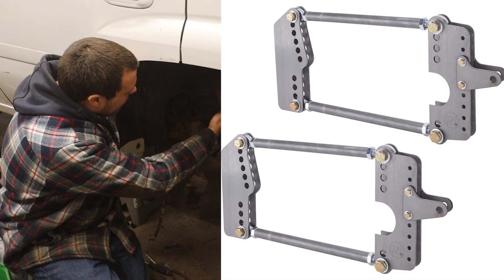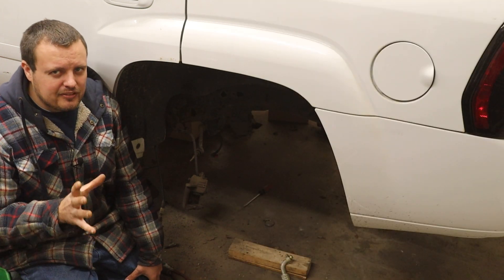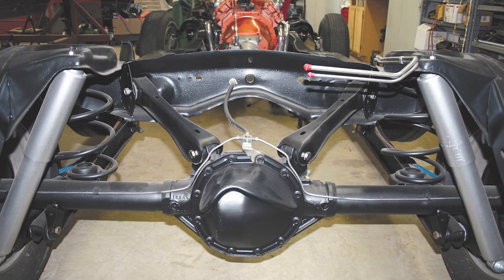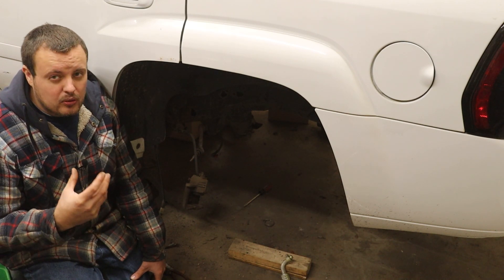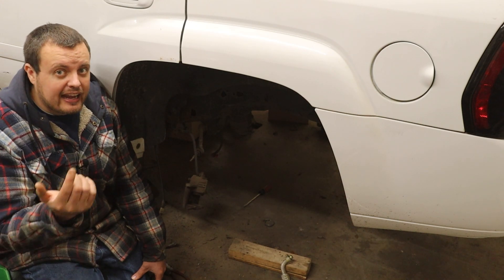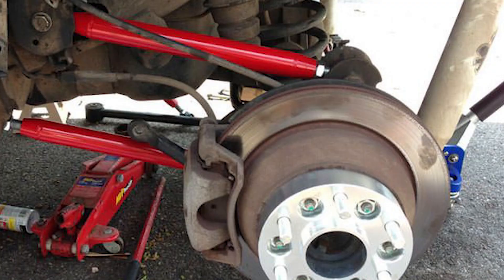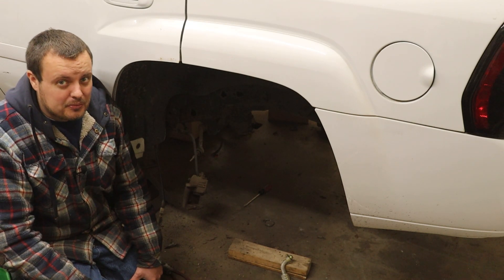A lot of times you'll see these brackets with tons of holes in them on the top and bottom so that they can be made adjustable. Most of the time, if you see a four-link on a factory vehicle, it is what is called a triangulated four-link — like what you'd see on a Chevelle or a Fox body Mustang. These are also a great suspension type, but on more serious drag cars you will almost always see a parallel four-link. What's cool about this vehicle is it has a parallel four-link from the factory, and while it doesn't have much adjustment — only one hole to choose from in the front — it's actually not poorly set up as far as bar angles go.